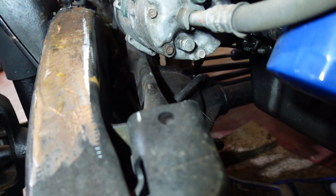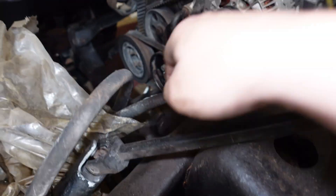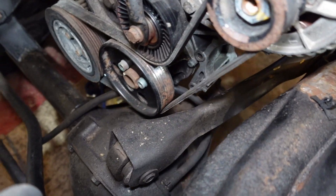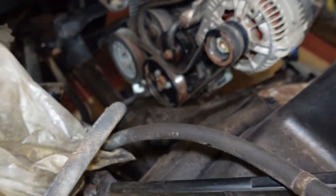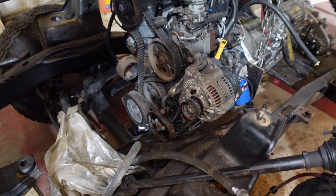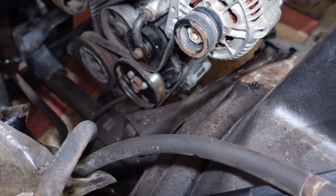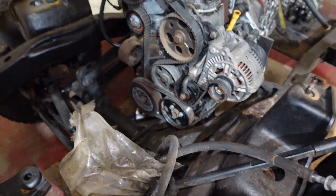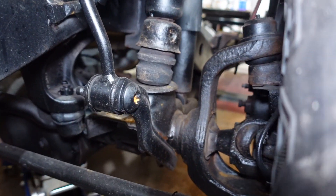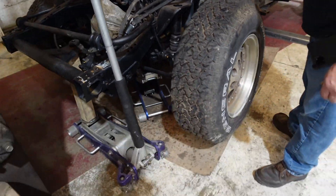You can see it a little better where our suspension is hitting the air conditioning compressor. So we took the air conditioning compressor out — I don't think that's going to work — and then jacked it up. See how close the diff is? We pushed the motor to the passenger side to help with the air conditioning compressor, then moved the motor back and got it pretty straight. With the compressor out, the clearance is much better. It's still close, but we're right on the bump stop compressing it — so that's where it would be if we were up on a rock or whatever.